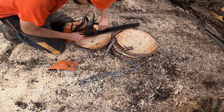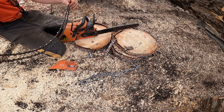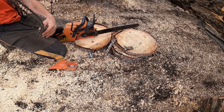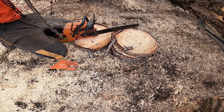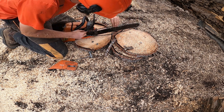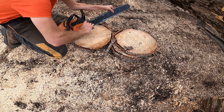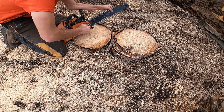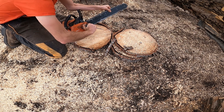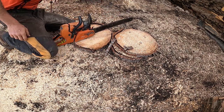All right. So there's our fresh, evenly sharpened chain. That's cutting nice. And we'll throw on our uneven chain. And we'll see if it cuts crooked. It should. In theory. These Echoes like to loosen up just a touch, I find. So you make them a snitch tighter. I think it's just the cover style plastic. All right, that should work. Let's give this a shot.